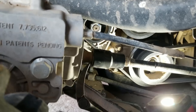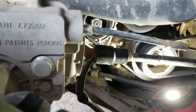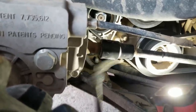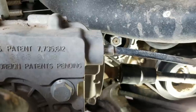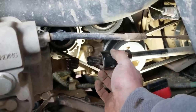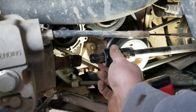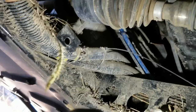With a couple dozen foot-long heel bar - some sort of rubberized something or other - maybe it's just all the schmoo that doesn't want to come off. Not so tough now, are you. I thought that was a set screw but turns out it's a grease zerk, just a grease fitting. So that is supposed to slide. Something allowed this to pile up and pull forward out of the coupling.